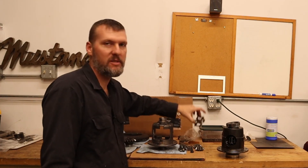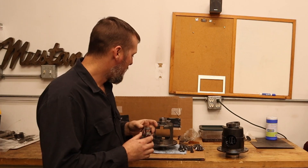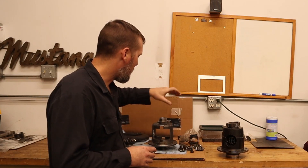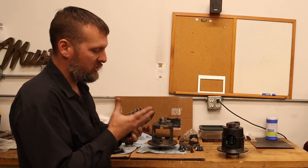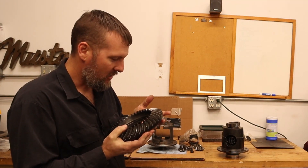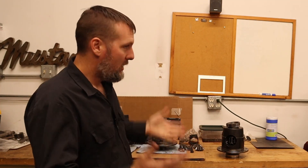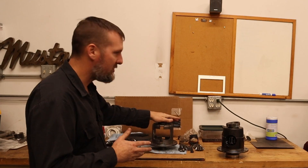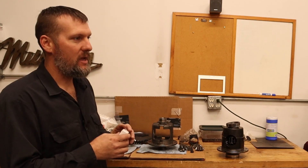I've looked up some tips to be able to get the S-spring clip back in — apparently that's the thing people have the most trouble with. Some pliers can kind of get that to go back in, so I'm not too worried about it. Using the same gear set, nothing looks wrong with it, so I don't think any of my metal is coming from the gears. The only thing I can think of is the metal is coming from the differential.